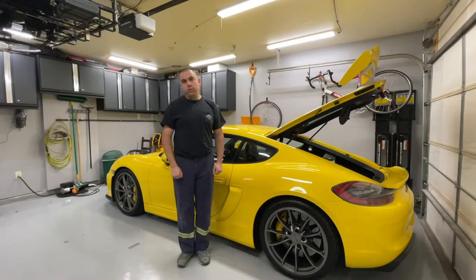Hey guys, GT Machine here. I'm just going to go ahead and do my second oil change on the car since I've owned it. I did the first one about two weeks after I bought it because the Carfax showed one done within the last two months before I bought it. It's got about 2,000 miles on it but it's been about a year, and usually about a year is when you should let the oil sit before it loses all its detergents and additives and they start breaking down. So I'm going to go ahead and get it changed and show you the supplies.